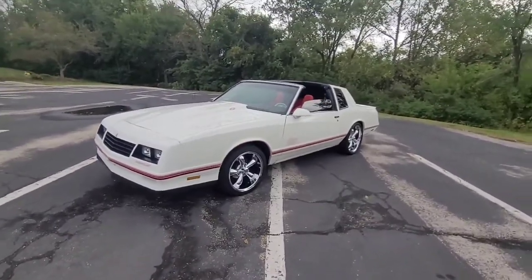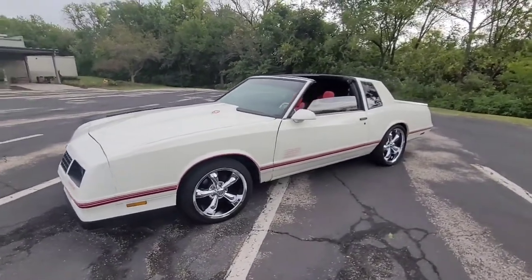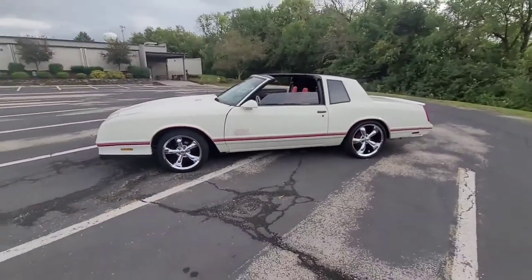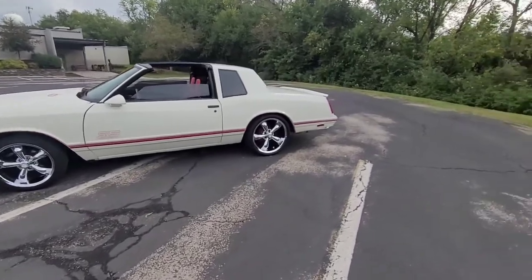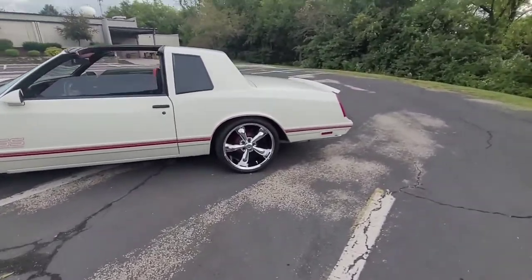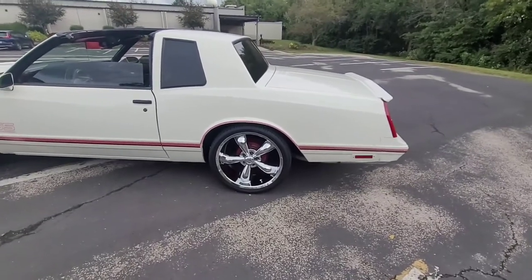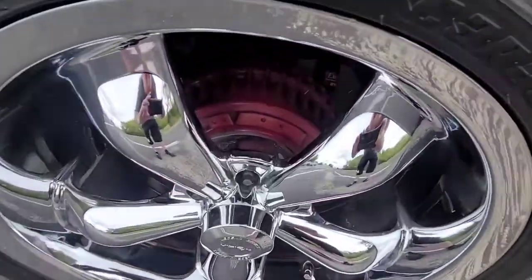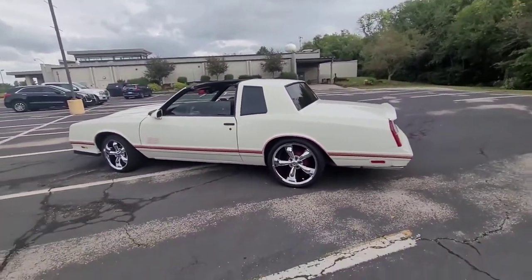Alright, I'm at the spot now where I film my videos. So putting the wheels on it — they're 18s in the front and 20s in the rear, pretty decent sized tire. It's got a 275 series on it and it was barely hitting the frame when I first put them on, so I'm running a little quarter inch spacer back here. The 18s in the front — really liking the look.